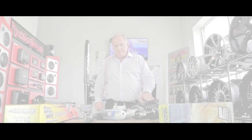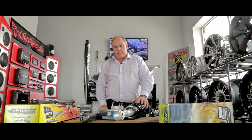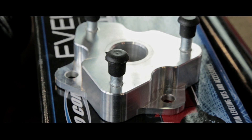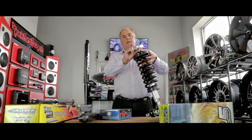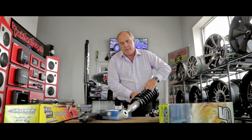Let's get into it. This topic would apply to just about any of the North American truck brands, and for that matter, even some of the Japanese brands as well. A very popular way of achieving a small lift is the leveling kit, and that's your least expensive way of entry. The leveling kit is essentially going to be a spacer that goes on top of the factory strut, so you're not changing the shock, the damping rate, or the springs at all.